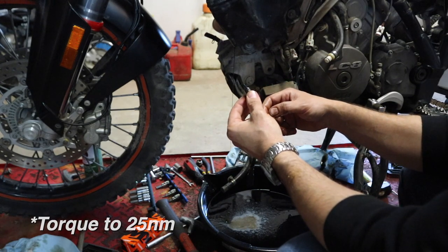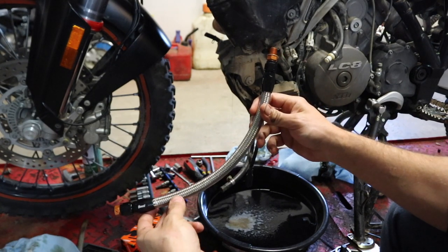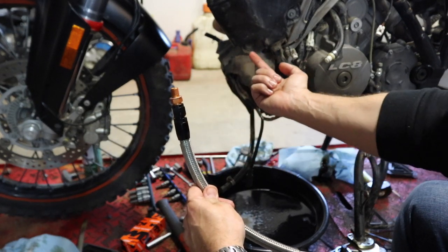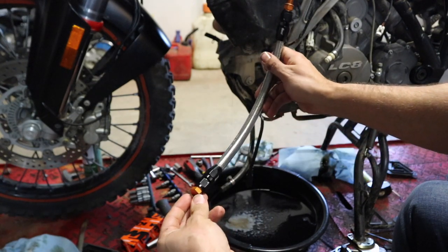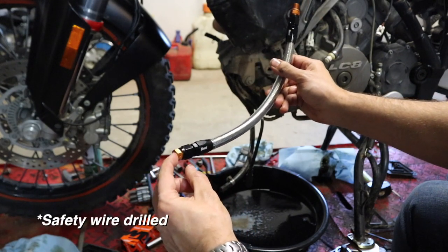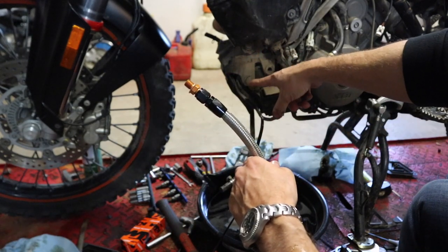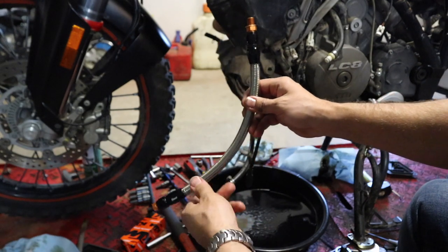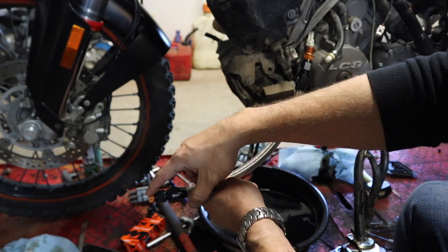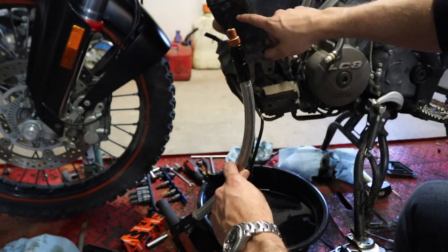This is something I picked up from CJ Designs — it's around 100 bucks, a stainless steel braided hose. Once this finishes draining, we're going to thread this up here. On the bottom we have a drain plug that's actually safety wired, so if you want to run safety wire through it you can lock it into place. We're going to spin this in, then use a zip tie to put it down in place somewhere. That way when we have to drain the oil next time, we can leave the left-hand side tank on and just take out this drain plug down near the skid plate area.